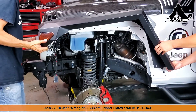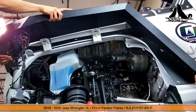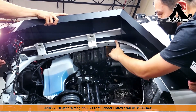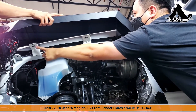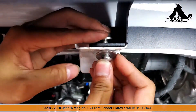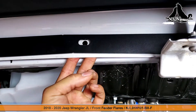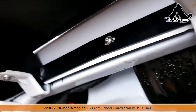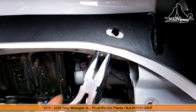With everything ready and prepared we can go ahead and carefully place that brand new front fender on the brackets. There are seven points to attach the front fender — five along the frame and two on the white brackets. Start by securing the top brackets first and then move on to the others. Now you will be working with some tight spaces — initially you'll be able to use your fingers to position that nut in the back and get it screwed in.